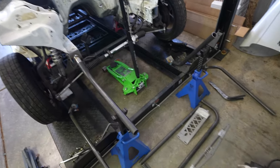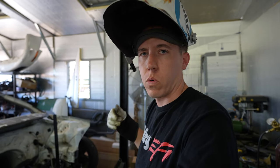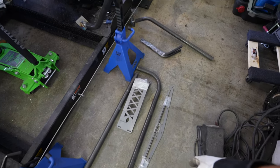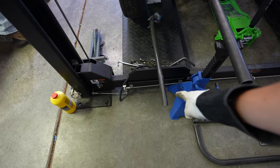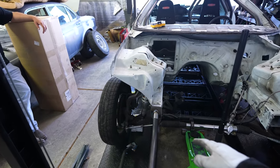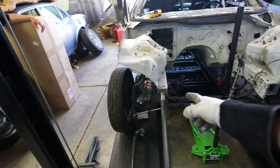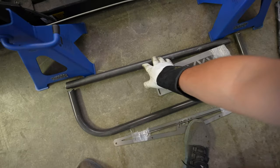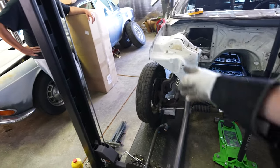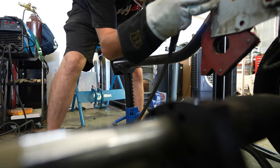I got all the pieces out of the box and went with the complete kit, which includes the headlight brackets and everything to put it right back to where it was. Here's the front piece where everything mounts on the front bumper, the down tubes, main frame rail tubes, another down tube, and the little mounts that go across the back. We need to start tacking — the instructions say to tack inside-inside or outside-outside so you can manipulate the frame rails a bit to make sure everything fits.